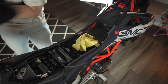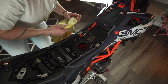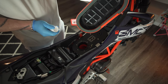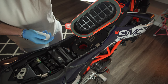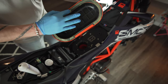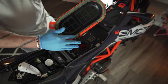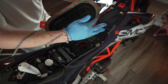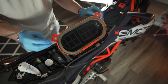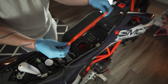While that's drying it gives me time to take a look underneath and make sure that we are still clean and nothing is dirty. I'm going to put rubber gloves back on. This filter is now dry and tacky, so I'm going to add some rim grease - just a deliberate amount on the outsides. What this will do is help create the seal between the filter itself and that mounting plate, so even though this is attached to the bike I still want to make sure no dirt, dust, or grime can get in there. As you remember on these filters, you've got that plastic tab that's got to go on one side and clamp on first, then we can latch the two metal pieces.